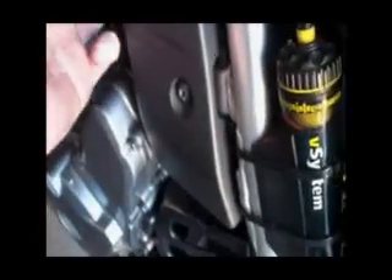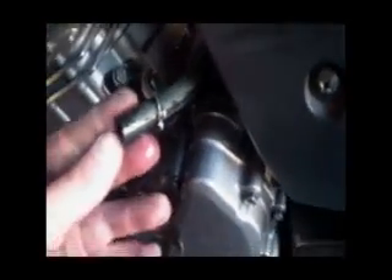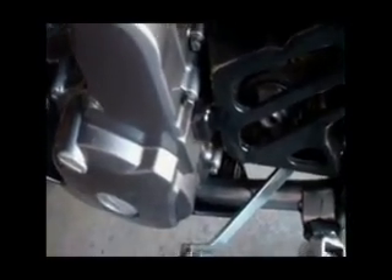Now to remove the tank. I've got two 10s here again. Remember to loosen this breather hose, and turn your tap to off. Then you need to remove the tap hose — you've got two hoses on your tap: the vacuum and your petrol hose. The hoses are removed. There's your petrol pump — don't worry about the bit of petrol leaking. And the vacuum hose is here at the back.